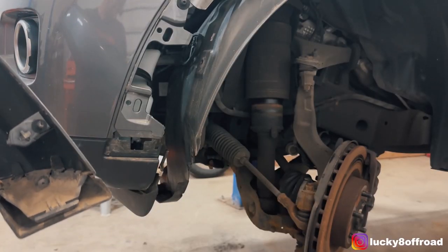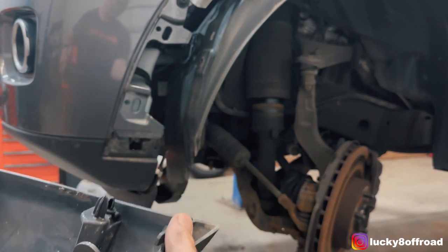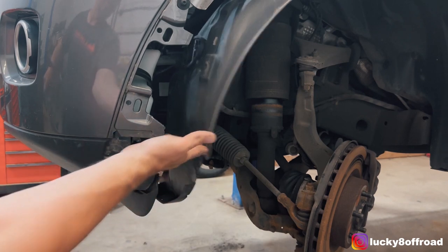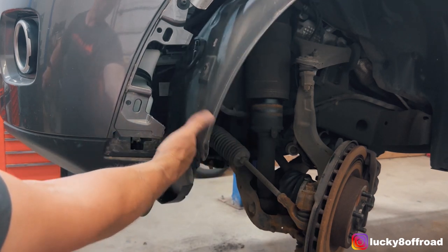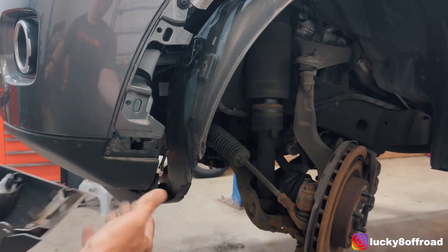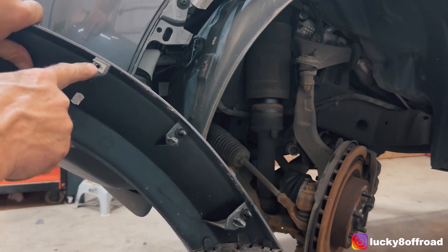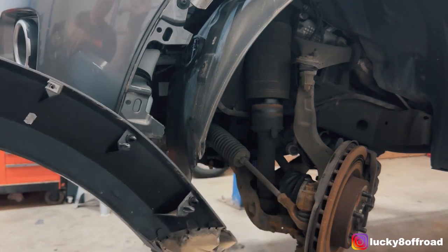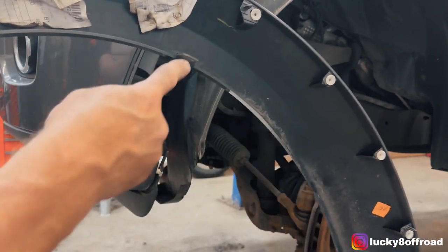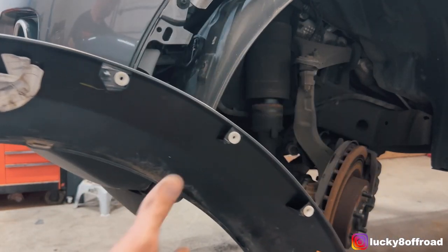Here's another little tip — this little tab slides into the bumper right there. What I did is I pulled the inner liner out of the way and pushed up on this plastic piece to get it to pop out. Once I did that, all the clips came loose. There's the screw we took out — or else we'd snap the flare. Popped them all out, got the two mounts for the inner plastic clippies. This fender flare is off. Time to move to the next step.